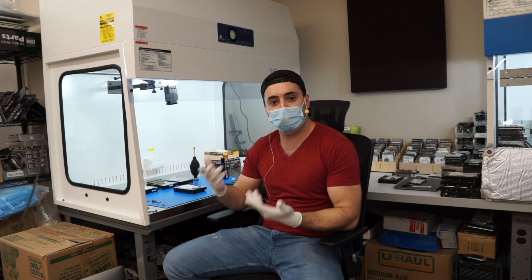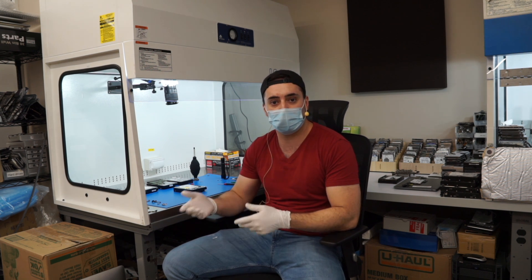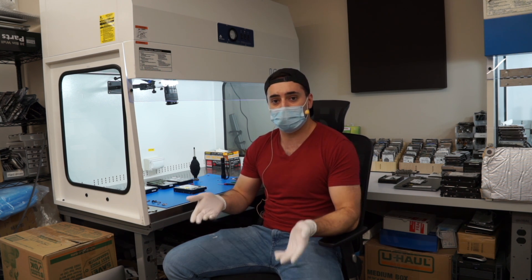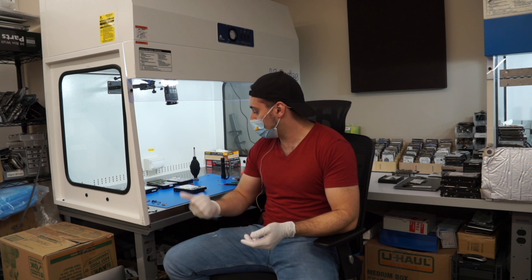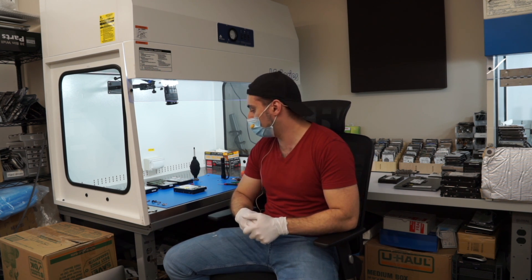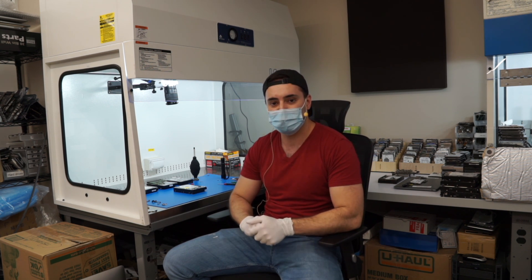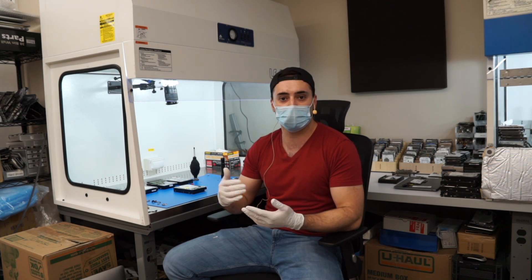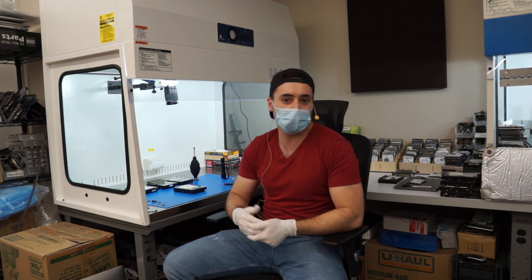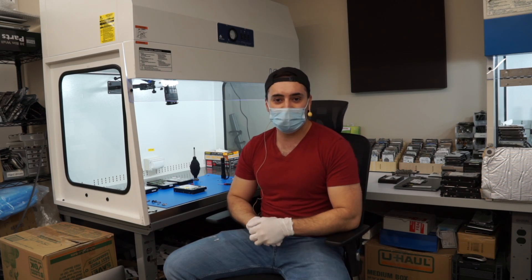So that was a quick video on how to fix a Western Digital hard drive that does not spin up when you've connected the wrong power supply to it. We get these a lot — hopefully this helps you do it yourself. You can just do it with a soldering iron. I might make another video showcasing removing it with the iron. Some people actually just rip it off, which isn't advisable — as long as you measure it afterwards and make sure there's nothing shorted, you're good. You're safe to plug it into your computer. That's basically it for today — enjoy your day, thank you.